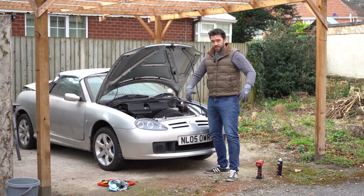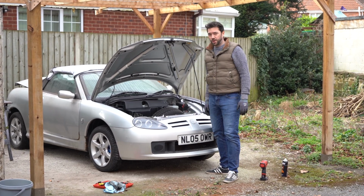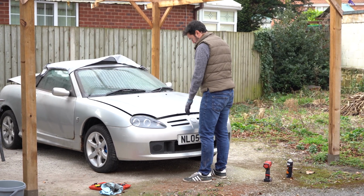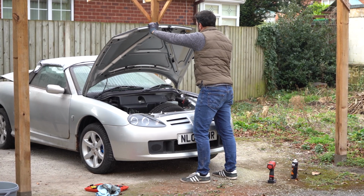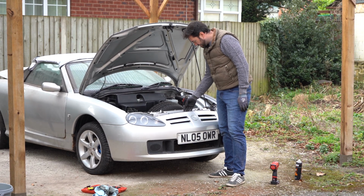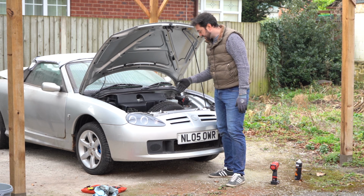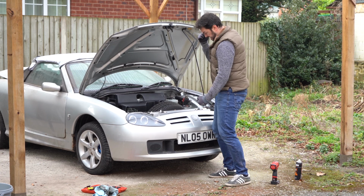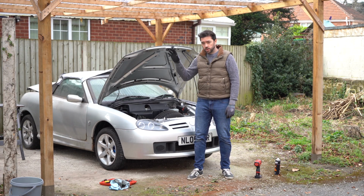Right, well, I was just about to turn around and go, well, that's another job well done, and talk about all the bits and bobs, but the bonnet won't shut. And I think what it is, it's a year's worth of being open, not all the way down, and a little bit of a piece of metal there that's supposed to spring back when it goes all the way down and then latch onto it. I think it's seized, so I'm going to keep spraying it with Plus Gas and hopefully I'll just work its way free. Arrgh!